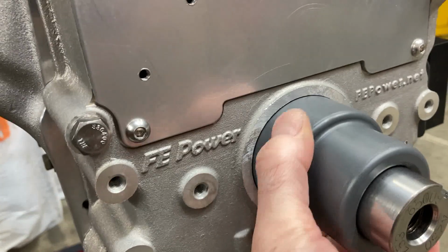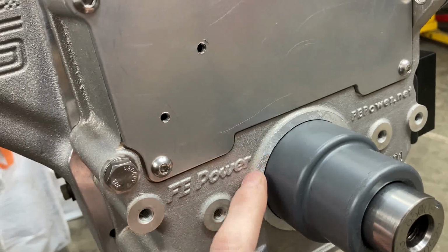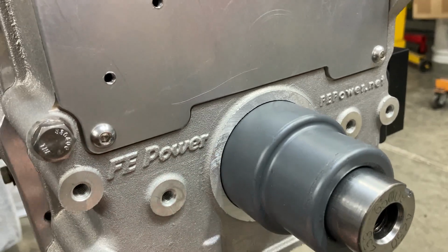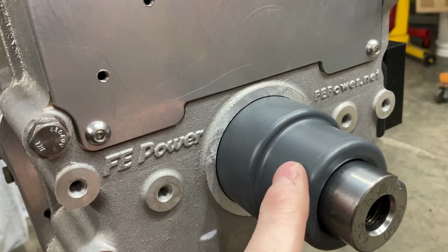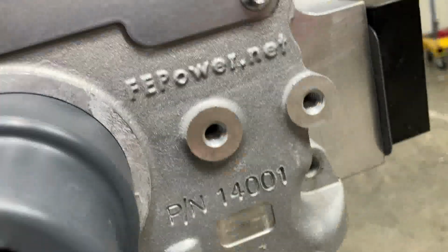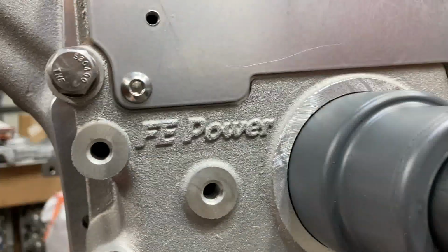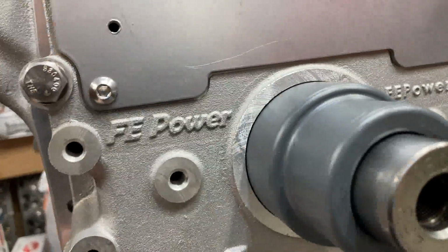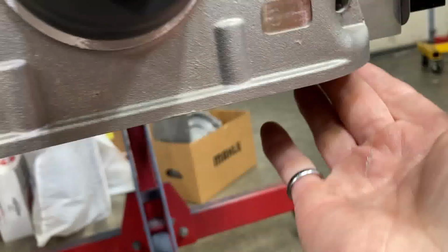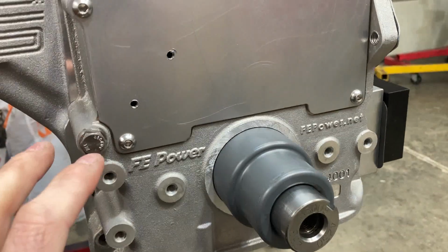So these are worth their weight in gold, in my opinion, and this bigger side will let you use the counter bore for a small block Ford, or for when you use Jay's timing cover and use a Cleveland seal or something like that. This is normally an FE side, but you want to look for an even gap around the outside of it. With the bolts loose, you can usually manipulate it whichever way you want. And then I feel of the pan rail and the timing cover rail to make sure that they're halfway flush, and then get the rest of my bolts in and tightened up.